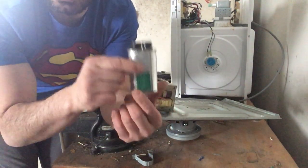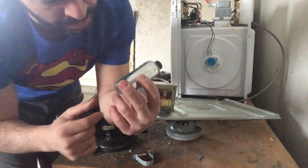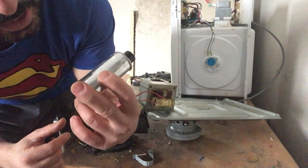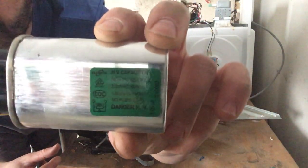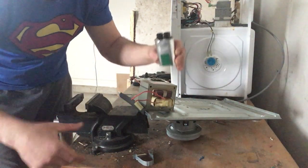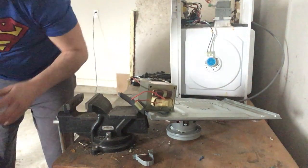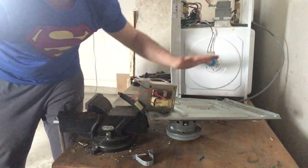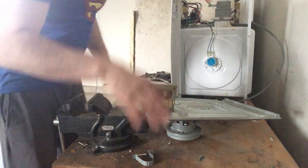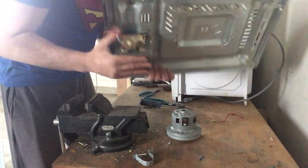This is your danger zone — the capacitor. If I look at this, it just says 'danger, high voltage,' so you definitely want to be very, very careful. Make sure that you leave it and let it sit before you tackle this. Now that the capacitor is gone, there is no more potential of an electric charge. I already also have my transformer here.